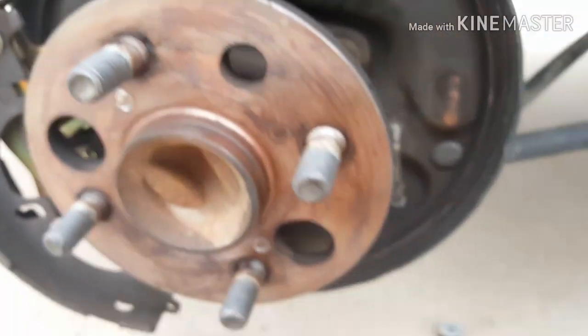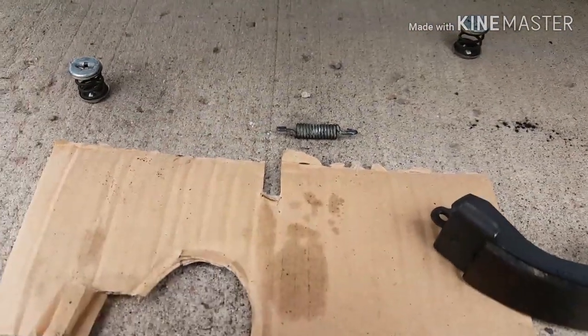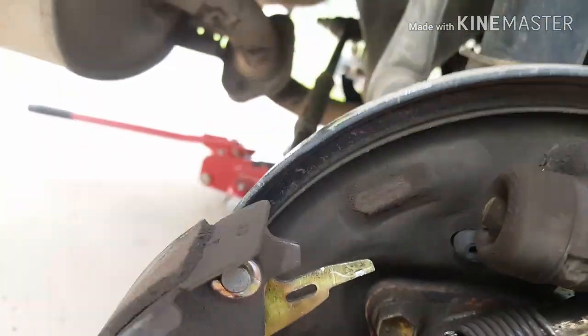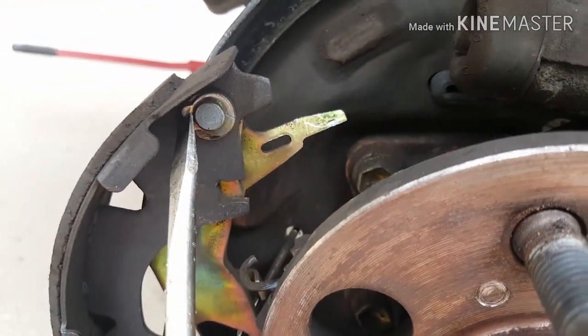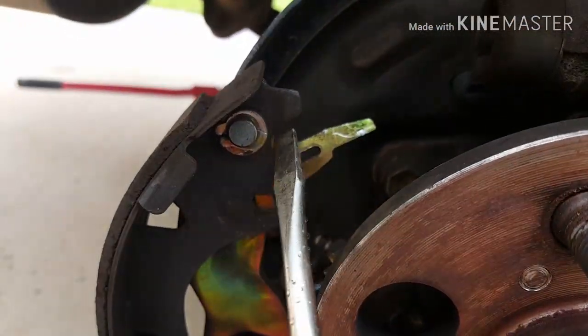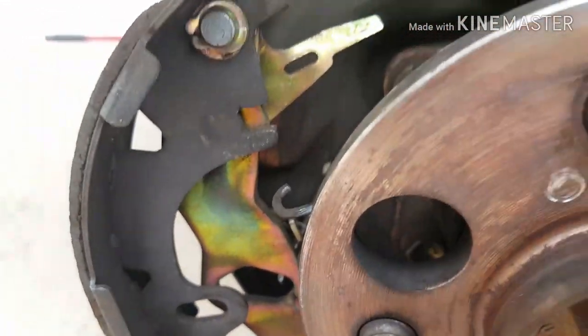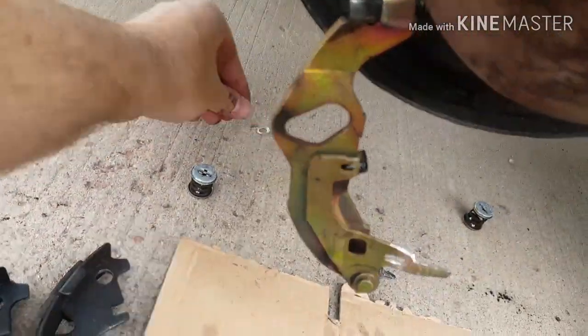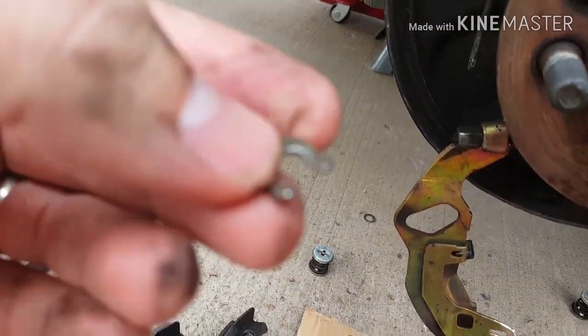With all those off, the right shoe comes right off. You can do that little bottom spring by hand. There's also a little pin here — you just take a flat head screwdriver and separate it there, pop it off. Obviously don't lose it. Then this pulls through and you'll be able to pull the left brake shoe off. It takes a little bit of work to get this little pin off, so be careful — don't lose it or the washer that was behind it. You've just got to work it with a flat head screwdriver.